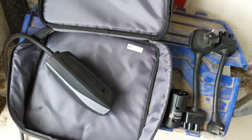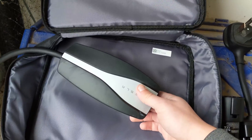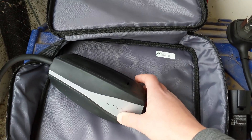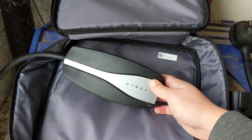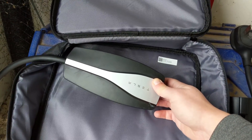For the mobile connector, the generation 2 connector is limited to 32 amps, which is exactly what you need to charge the smaller battery pack Model 3. But the long-range Model 3 can actually go up to 48 amps, so this can't supply the full 48.